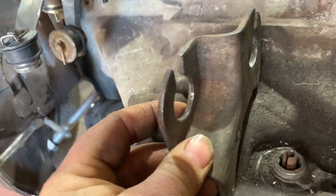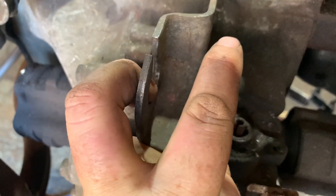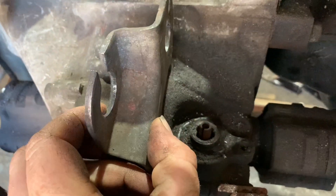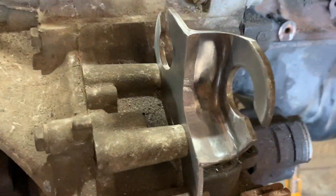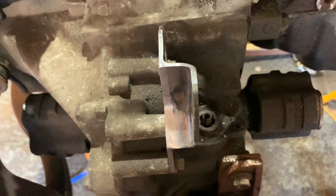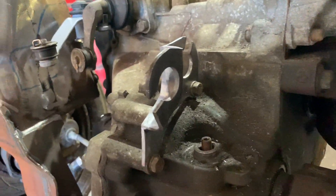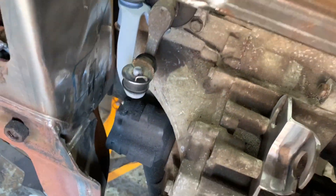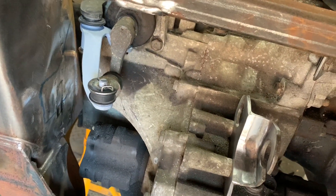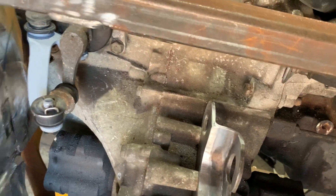Next thing we've got to do is modify this bracket - that piece sitting over to the left has got to be the same distance over the other side, so it's got to sit over there somewhere. I've now moved the selector arm across and also further in towards the engine, so it should clear the bulkhead up on the car. There's also plenty of clearance for the speedo cable - it'll miss the bracket. Looking good so far - we're just going to pop some cables on it and make sure they look like they're going to do the right thing.